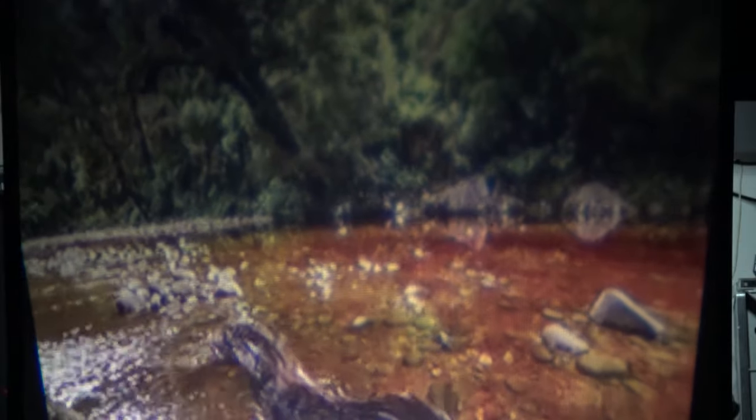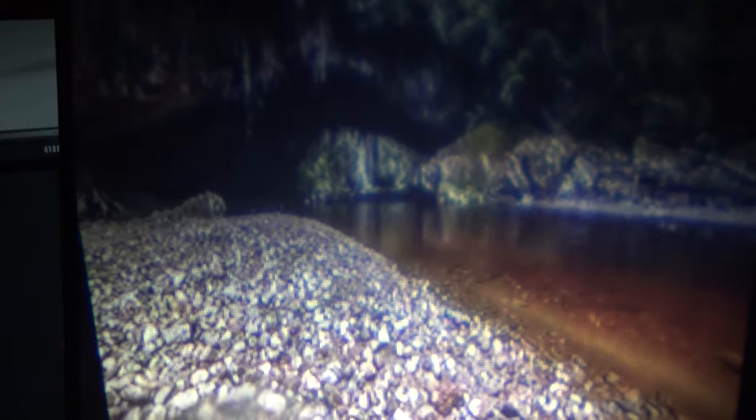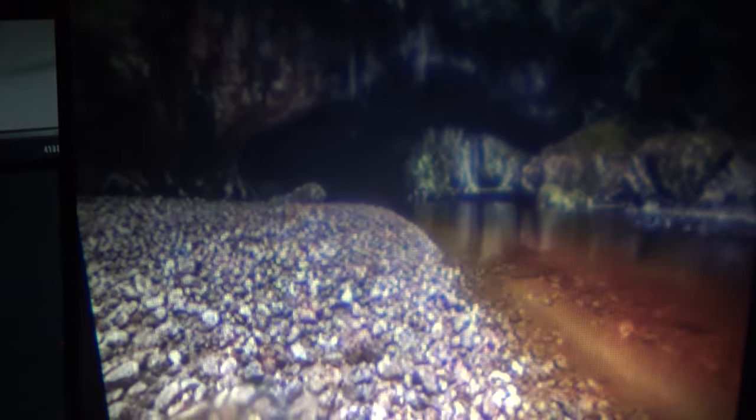There's the picture off the high gain screen. I'm going to raise the camera up a bit to get optimum brightness, because off these screens they have a relatively narrow angle of vertical view. These high gain screens are designed for rooms that have some ambient light. A conventional projection screen is completely white and reflects all light, but these ones are actually silver — they only reflect light in the direction of the viewer and reject light coming in from other angles, giving us the best possible brightness from this device.